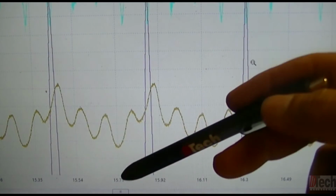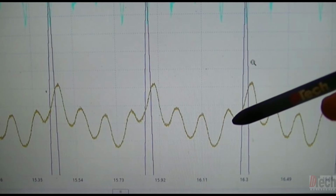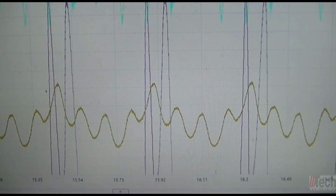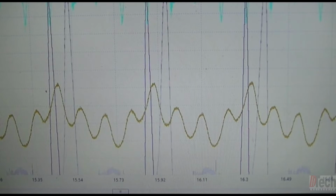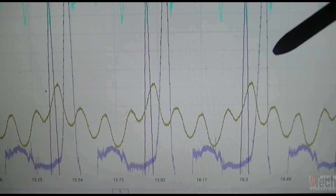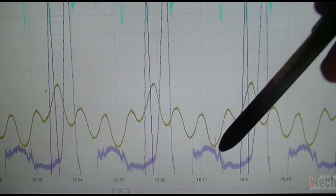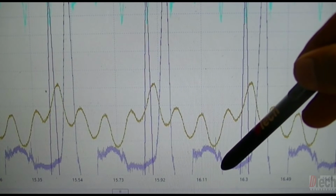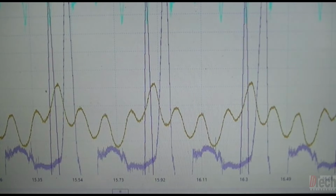In this case, this is not the cause of the rise of pressure levels here in the manifold. And the other factor that can cause what appears to be a pressure rise in the intake manifold trace can also be due to, so if we come up here, this is cylinder 3. So cylinder 3 compression going towards TDC, cylinder 3 compression TDC. Here's your expansion, exhaust valve opens, here's your exhaust stroke, and here would be the intake stroke before the valve closes and compression is created.